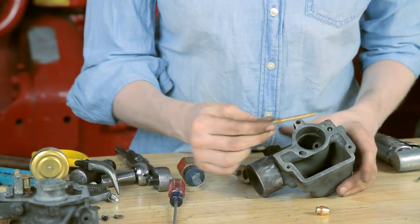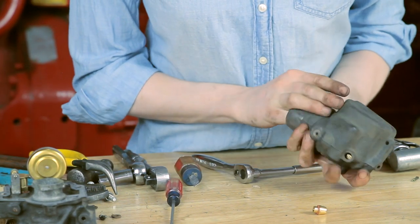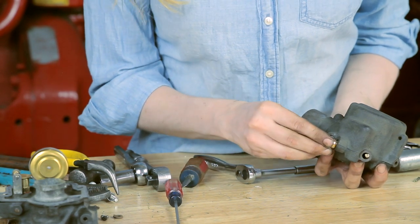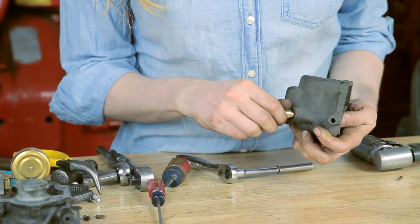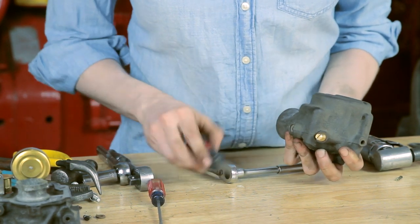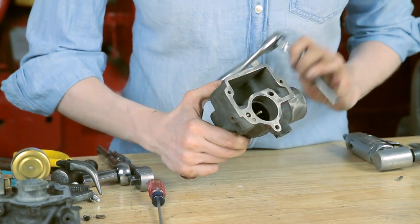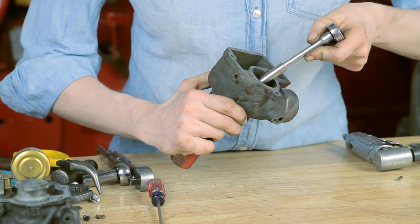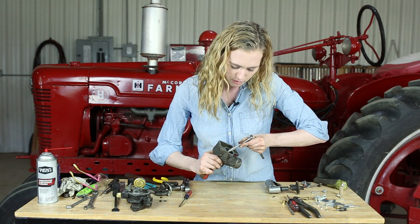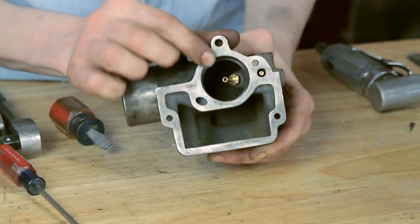Next, we have our emulsion tube. Notice that there's a gasket on the end. I'm going to drop that down into place and hold it with my thumb while I flip it over. There's another gasket that goes underneath there, and I'm going to get it started with my fingers — that seems to be the easiest. Once you get it tight, notice there's a head on here for a screwdriver, which I can hold while I use the deep-well socket on the other end to tighten it up. Tighten your emulsion tube up just like that.